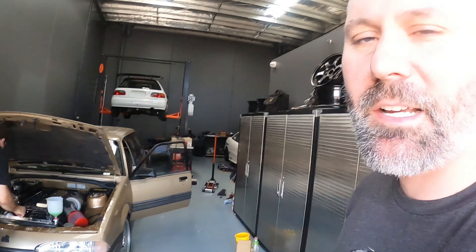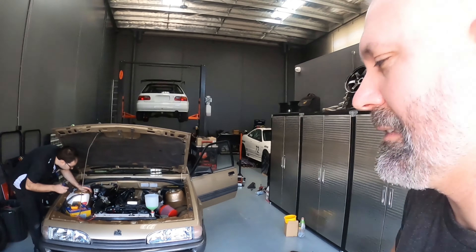We sent the car down to Advanced Auto Electronics — my good friend Vel, he owns and runs that shop. We'll jump to some footage of that soon and show you the work he's done. Long story short, the Haltech is in the car and it is running. We called Fernando, my good friend at Haltech, who always helps me out. Straight on the phone, straight into the laptop, plugged in, punched a few settings, loaded up the injector size and the fuel — just unleaded at the moment for the run-in. Selected RB30, boom, fired the car straight up, and everything was absolutely perfect. Couldn't have been more happy with that.